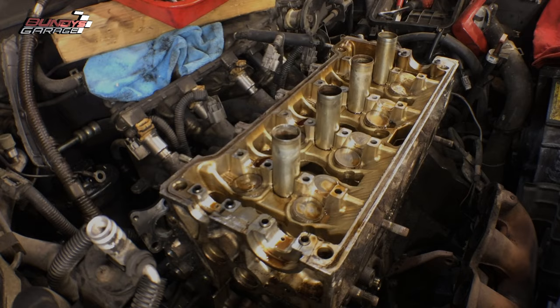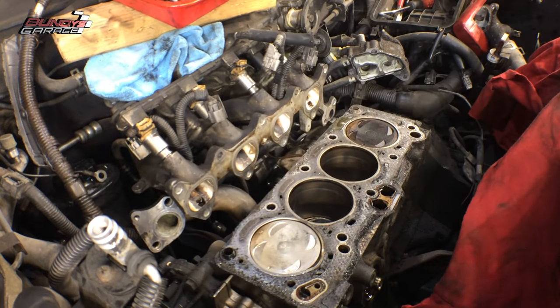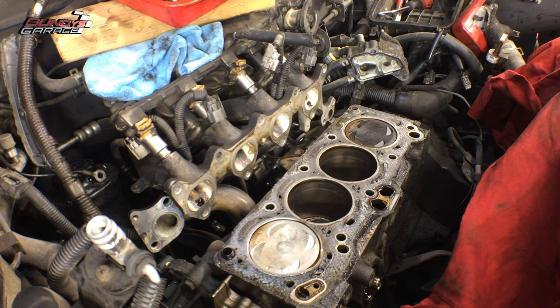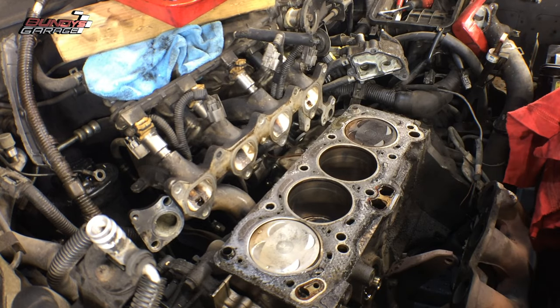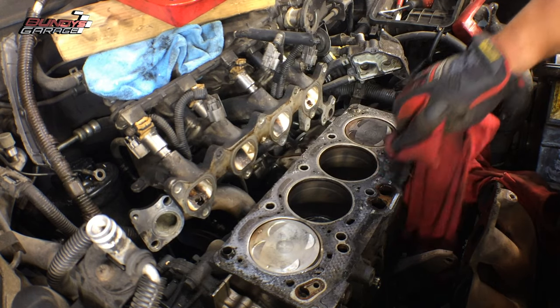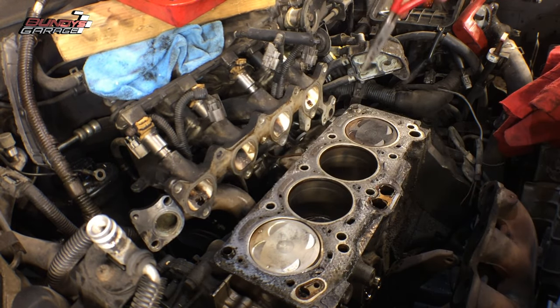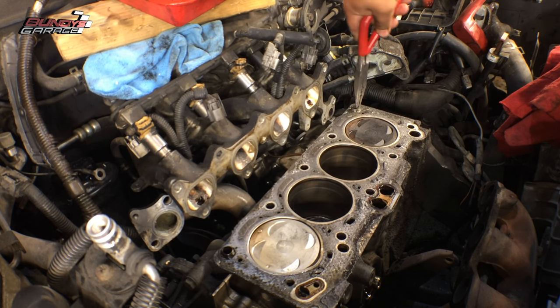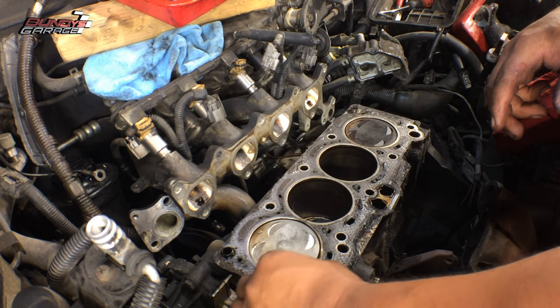I've got some gloves on, a rag ready to go on top of the engine block, and I just pulled the cylinder head right up and out. This little cylinder head is not heavy at all — very light with the cams out. There's the engine block and there are the pistons. The top of the pistons don't look bad at all. You can see the one closest to the camera — it's all shiny and sparkly and clean. That is actually caused by the head gasket being blown. Basically, as the coolant went in there and boiled off, it steam-cleaned the top of that piston. All the other pistons have carbon buildup on top; the one on the far left does not.